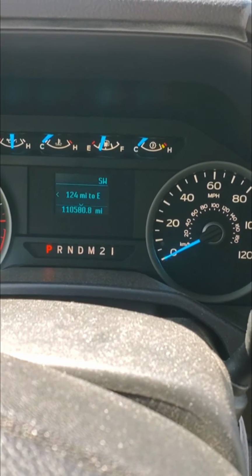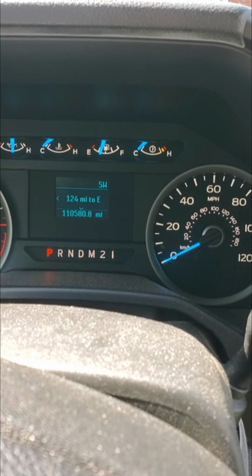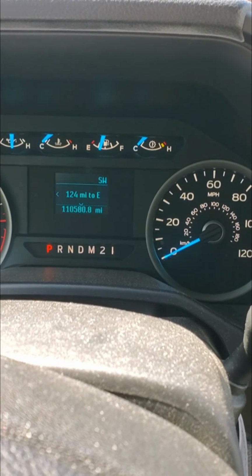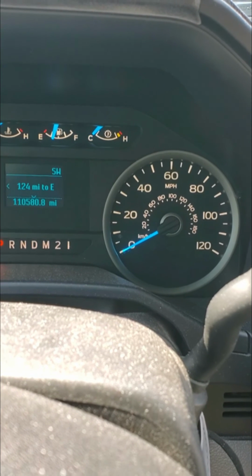The leak definitely had a huge air pocket in there. As soon as I replaced the parts, filled and bled the system, road tested it, made sure there were no air pockets in there, let it cool down, made sure there were no more leaks, and everything seemed to be, well, hunky-dory. So hopefully this video helps you.